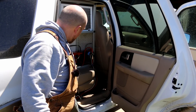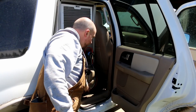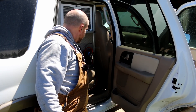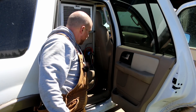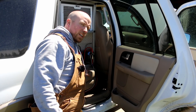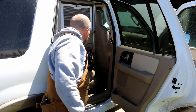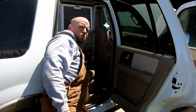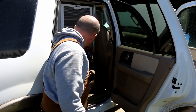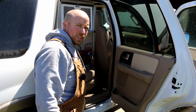In the back we have our inverter, our secondary battery, and our relay. We have the negative and the positive coming in from the engine compartment, the ground going to ground, the positive going to positive, and our ignition signal wire. I've tested it and everything seems to be working fine. The battery is just a little bit warm but nowhere close to where it was, and it was pretty discharged. The inverter is sitting at 12.9 volts — looks like we're in a good spot, but we'll do a long test and see how it does.